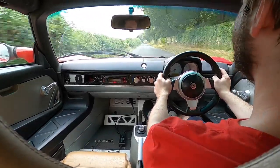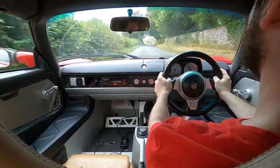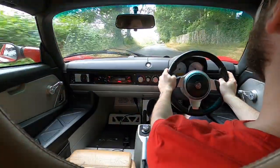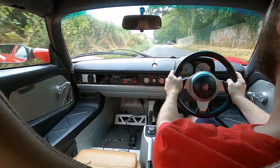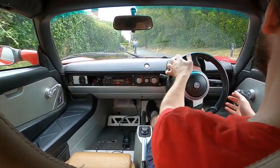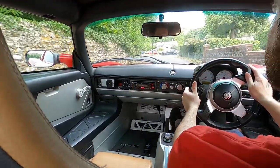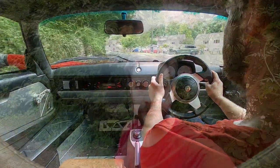We're almost back to where we started. After our drive, we're just going to put the car on charge — we want the car fully charged at the moment so that it can balance all the cells. There are a few cells in the battery pack that aren't fully balanced, meaning they're not quite at the same voltage as all the others, so we want to keep it charged so it can balance out the pack.